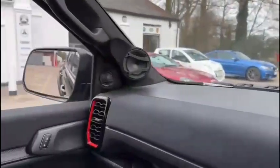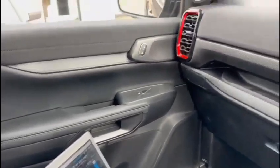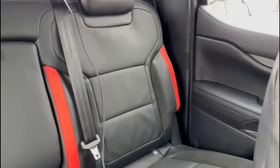They look pretty stunning. There's the other side — you've got a six-and-a-half inch in the bottom of the door and a four-layer soundproofing system, a tremendous amount of work in there. Then you've got the three-inch, then you've got the tweeter. That's an active system.